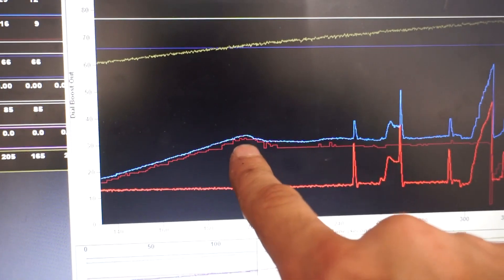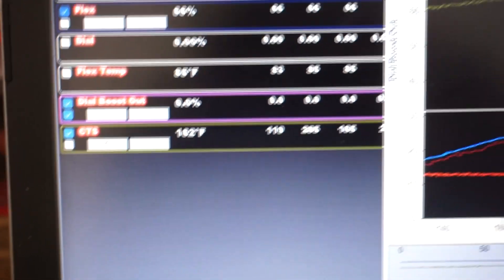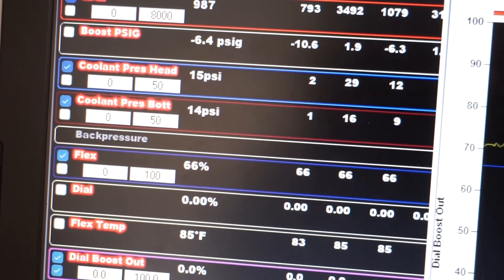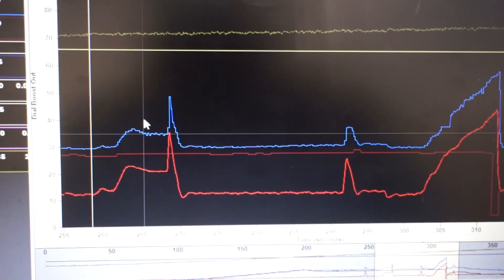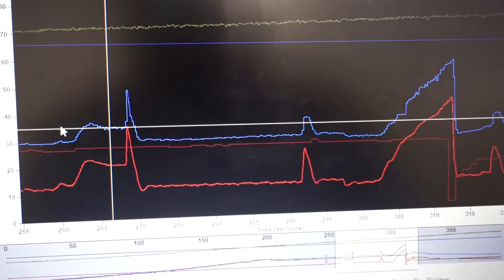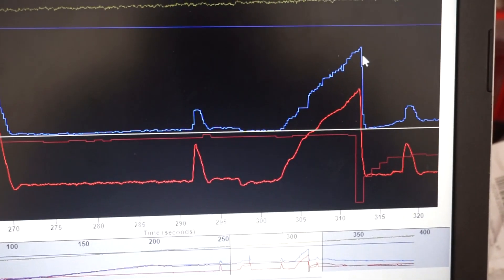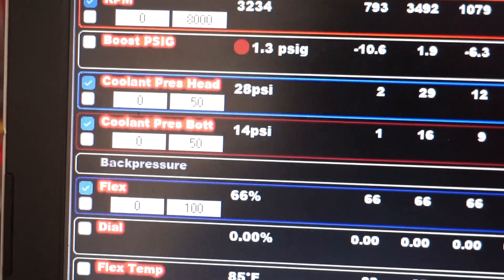The blue line is sampling five times per second, which is why the red one looks a little choppy. Here's the RPM coming up - both of them come up and peak about right here, which correlates perfectly to the 160-degree thermostat in the truck, and then they both come down about 2 psi. The tank pressure stays flat the whole time at right about 14 psi, but the head pressure correlates perfectly to RPM. This is 1600 RPM right here and just going from a thousand to 1600 RPM brings the pressure up. Here's a throttle blip - pressure comes up, and then going on the brake into about two pounds of boost it spikes up to 28 pounds of coolant pressure in the head while maintaining 14 pounds in the end tank.